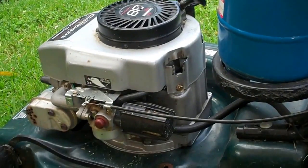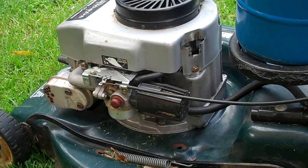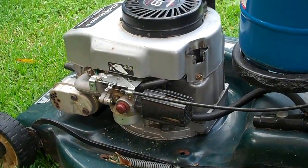The other thing I did was seal the primer bulb on the carby just to make sure there wasn't any gas going to leak. So I'll start it up now and we'll see how it runs.